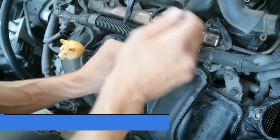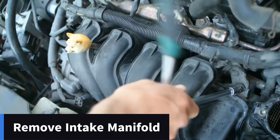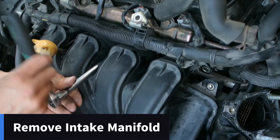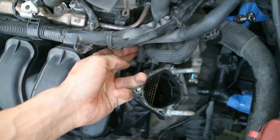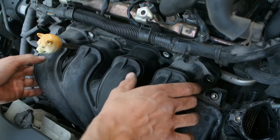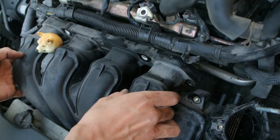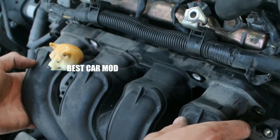With all of that done, you're going to want to remove the intake manifold. This is a pretty easy job — I think there are just a few 10mm bolts along the intake tubes into the engine. I have to stress: make sure you remove the intake manifold first. I've seen videos of guys that remove the fuel rail first — you're just going to get fuel squirting everywhere all over your manifold, which increases the risk of a fire. So remove this intake manifold first.